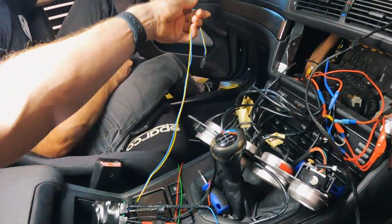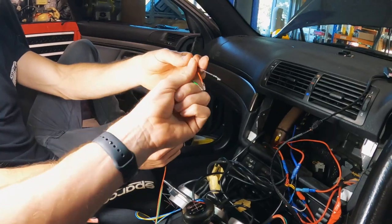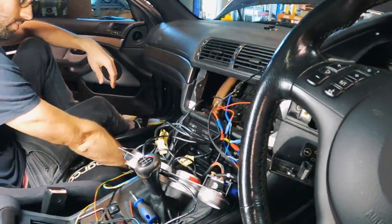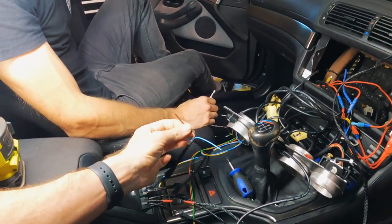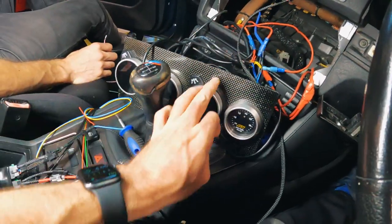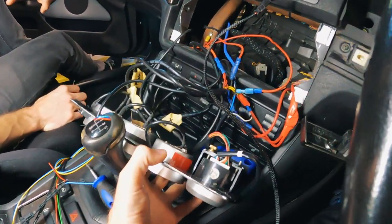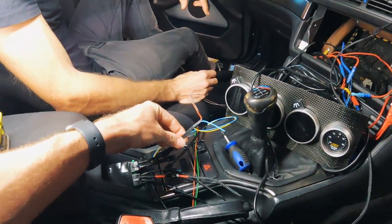All the wiring that taps into the original car uses CAN bus connectors — brilliant and super easy to tap into. The gauge gets its power through the dash cluster, and instructions are provided on which pins to tap into. The harness has a wire for an aftermarket EGT sensor and a blue wire for the AFR gauge signal. We'll still need to run the AEM gauge since it converts the O2 sensor signal into a voltage output. Luckily we can get AEM wiring diagrams online, so that one should be straightforward — assuming the scaling is the same.